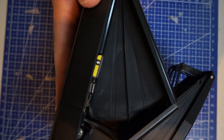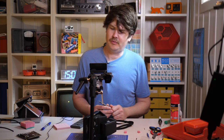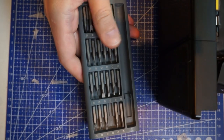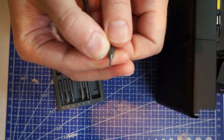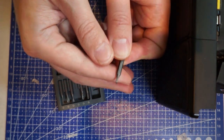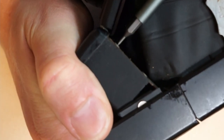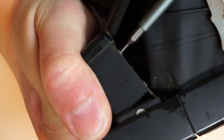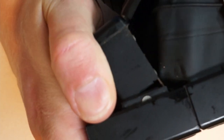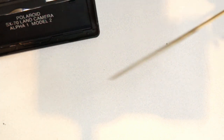On this camera they used a very special screw that is a 1 by 1 millimeter square screw head. I'm going to try to remove them with a flat bit that is 1.5 millimeters wide. I already managed to remove one of them — you need to press pretty hard on the screw. I'm going to use this file and make some grooves so I can use a flat screwdriver.